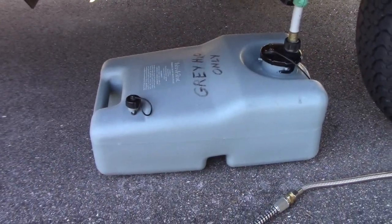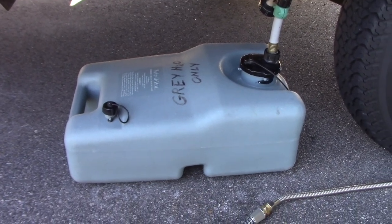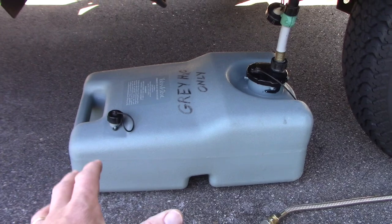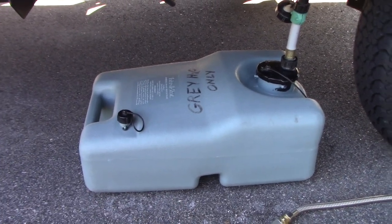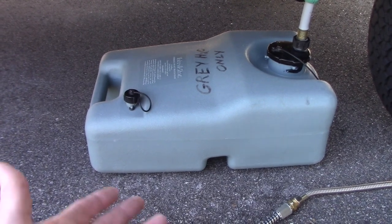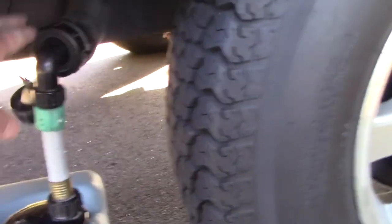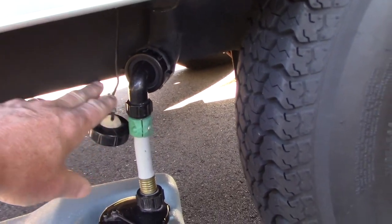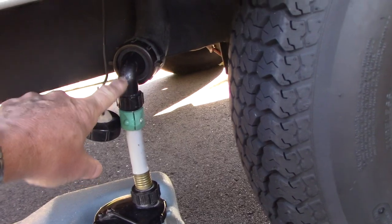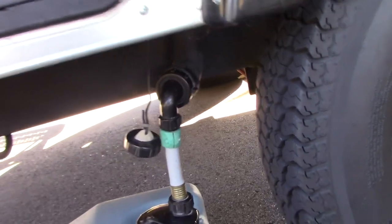Here's the waste tank that we use for our gray water. We never want to dump our gray water on the ground. When we take what I call a bootleg shower, we just do that with water so as not to pollute. This is a seven-gallon — probably about the smallest overflow RV waste tank that you can get — it's about all you'd want to try to carry to the toilet or the dump station. We just take ours to the toilet and carefully pour it in, and I keep sanitizer in it so it's clean and easy to do. You do have to modify a little hose to hook it up, as A-Liner gives you a non-standard drain outlet. You can buy these caps with a little elbow hose — that's going to be a male end, and you have a male end on your tank, so you need to fashion a little short length of hose with two female ends, which is easy to do. It works real well.